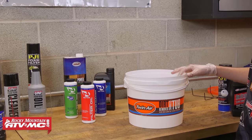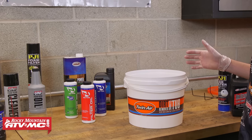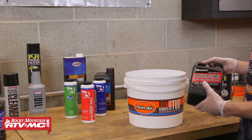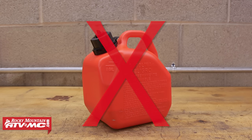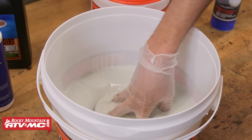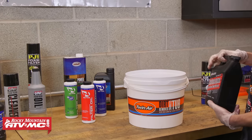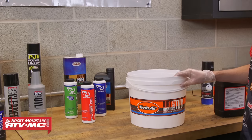There are a lot of different types of solvents used to clean air filters. A lot of guys will use an automotive solvent or kerosene to get the oil out of their filter. The best cleaners are the cleaners from the air filter oil manufacturers — they do a really good job at cleaning and they're safe. A lot of guys will also use gasoline; I don't recommend that because it's dangerous and it's actually harmful to the foam filter itself. The best method, whatever cleaner you use, is to totally submerge the filter in the cleaner so you can really rinse the dirt and oil out. For this video I'm going to be using Maxima air filter cleaner and the TwinAir tub. Whether you use one of these or a bucket of some sort is fine.